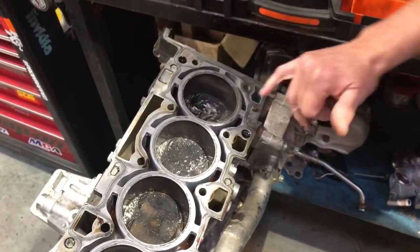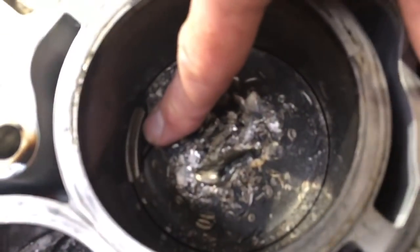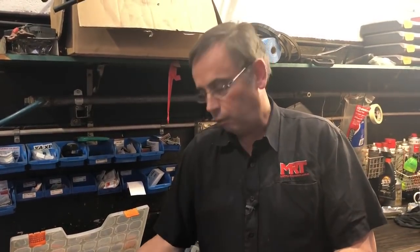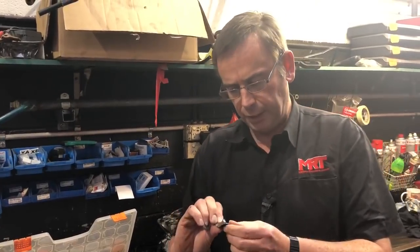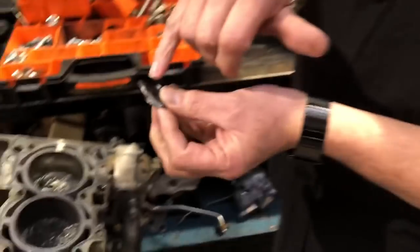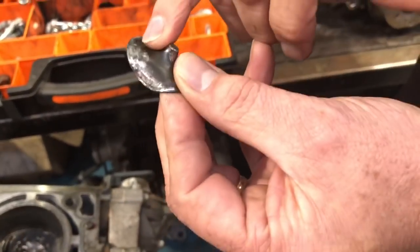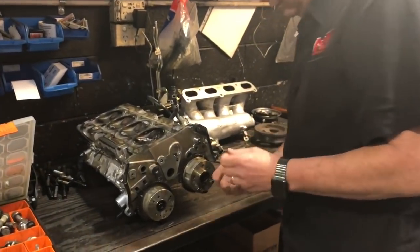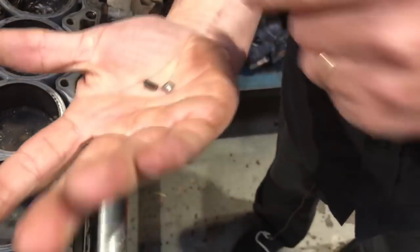It's smashed all the tops of the pistons. Luckily it hasn't done any damage to the cylinder liner, which means we can save the block. If you look down there closely, you can see the top of the compression ring and what's missing out of the side of the piston. There's a pretty good chance of what actually caused it — and I'm a big believer in finding what caused it — these engines are known for cracking off the tops of the pistons. What's probably happened is that missing part of the piston broke off, rattled around inside the combustion chamber, jammed underneath the valve seat — you can see marks on the underside of the valve seat here — then the valve jammed open, the piston came up and smashed it, breaking it sideways. It dropped off, rattled around the combustion chamber, and what was left of the piston went everywhere else.